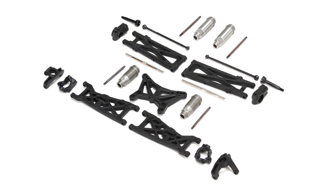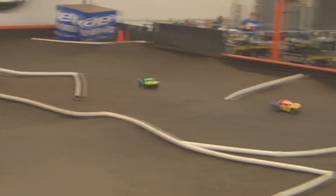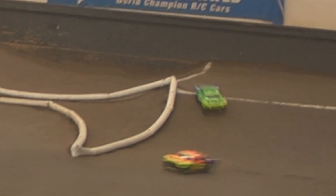We do have a new rear axle for the 22 SCT 2.0. We've really done a lot of work on the suspension geometry — more than just an update here or there. With an all-new front arm, rear arm, hub, caster box, spindle, steering rack, and shock lengths front and rear, the suspension geometry of the 22 2.0 is very much optimized and improved. All those little trick options we've learned on the 2.0 vehicles — we think you'll find it a lot easier to drive and get you in the victory circle even more often.